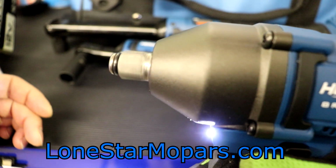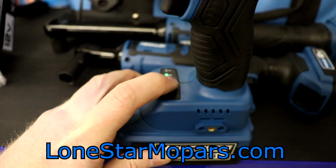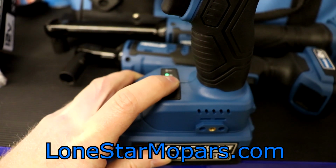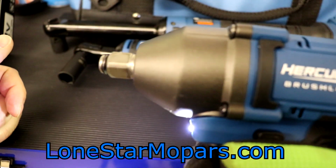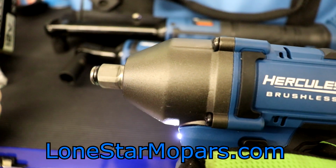It's about 1,000 RPM, right? We're going to come in right now to setting 2. Let me double check this. It'll be 1,700, which is about what I was thinking. Make sure that doesn't fall. You ready? We're going to feather it. And you should see this spin up 700 more RPM than it was.